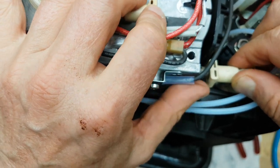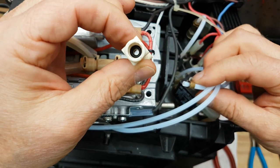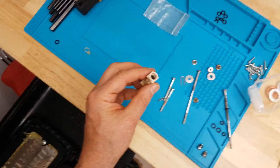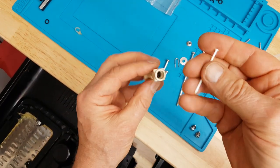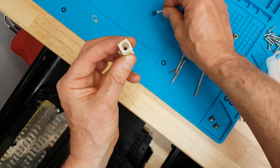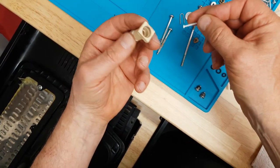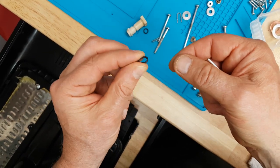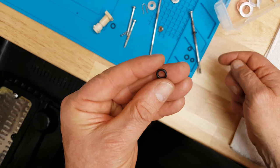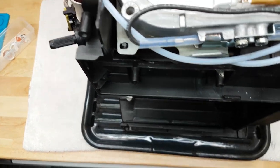Let's wiggle that out. There's the first hose, and there's a little gasket sticking in there as you can see. The way to get out this gasket — I use a little nail, and I try to grab the gasket with the head of the nail just like so, and then you can get them all out easily. If you have a look at these gaskets, they are not springy anymore, not soft anymore, they almost keep their shape. The new one here springs right back, but the other ones are pretty hard already. No wonder they're leaking.